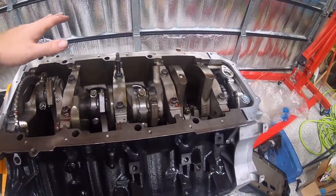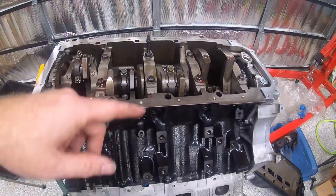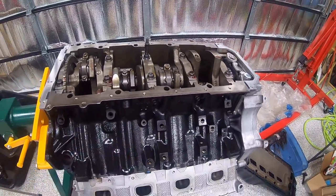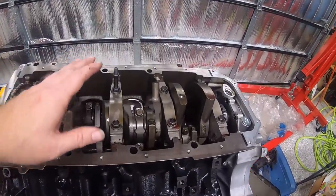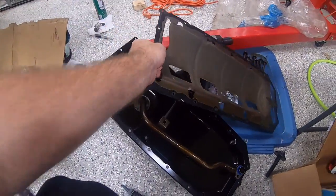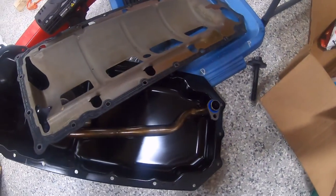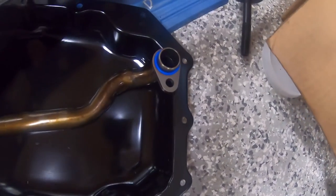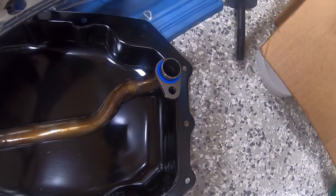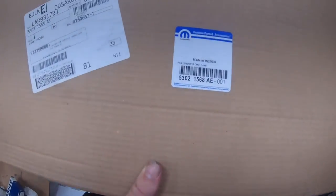Welcome back. The block is turned over and the surface is prepped with brake clean to remove any residual oil and grime, as we've done with every sealing surface. The oil pan gasket and windage tray are one unit — the replacement one is ready. We've got our oil pickup tube ready with a new O-ring that will mate into the oil pump. We want to make sure that O-ring is not flat and seats properly — if that seal gets compromised you'll lose oil pressure. There's the part number for the windage tray/oil pan gasket combo.